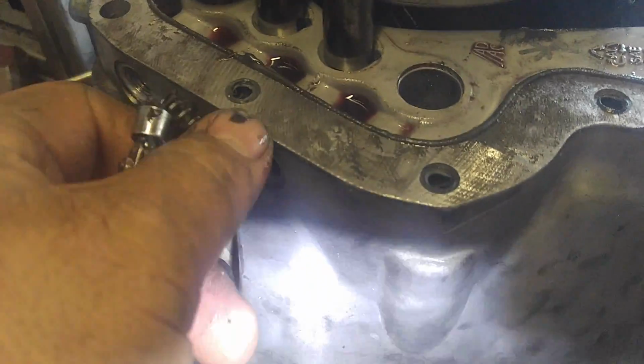But anyway, I did. Now I took these off next, and those are T40 Torx bit. Now, if you look inside, let me get a flashlight here. Okay, if you look inside the holes, you'll see springs. Okay, so what you want to do, these indents are what hold the shift levers in place, right? So pull the springs out, one in each hole.